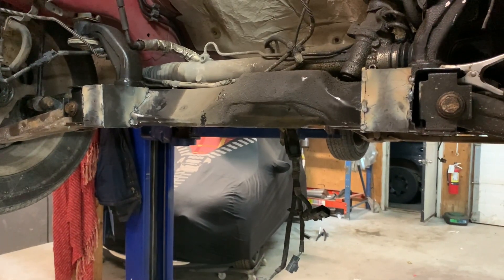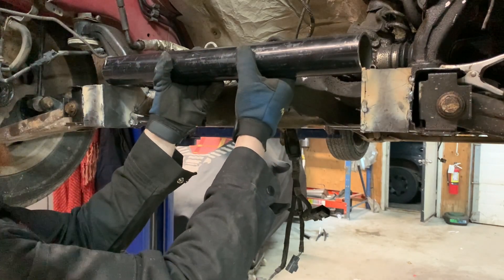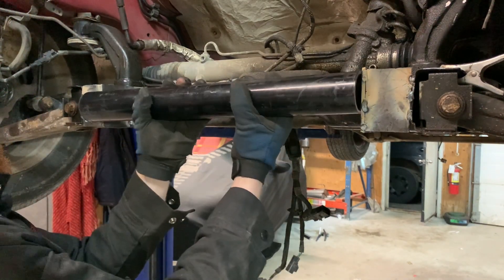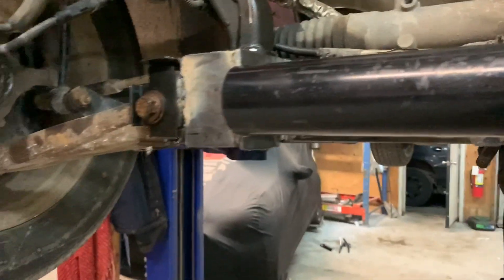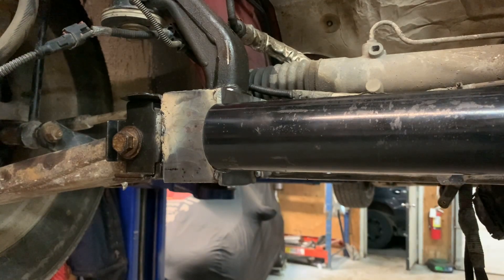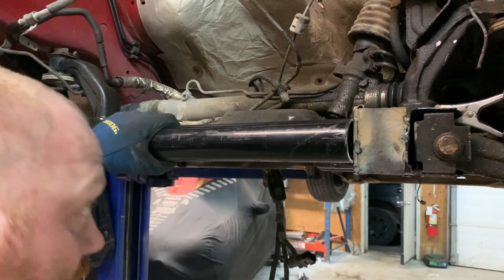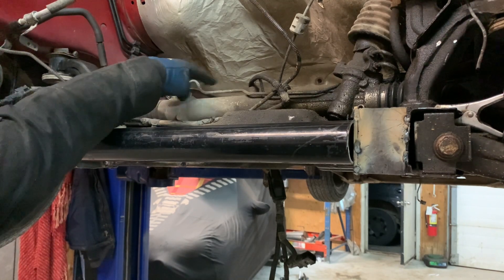In real time, let's see how it did. Let's see if my measuring tape is shorter than it's supposed to be. Now it's a sixteenth of an inch off, which I'm absolutely fine with. I'm going to make this crossmember low. I do have lots of room to either set it up high and be flush with this or low and be flush with down here. I think I'm going to go with low, mainly for the fact that I want the rack to be as far from the oil pan as possible. I don't want the transfer lines up here on the rack to be anywhere near the oil pan.